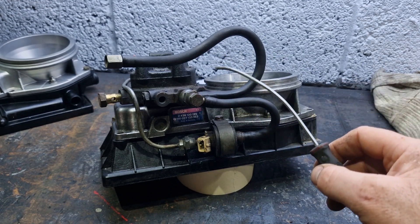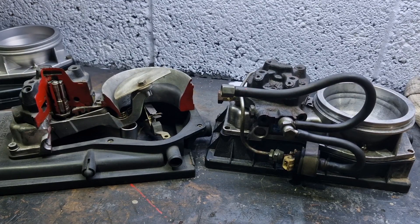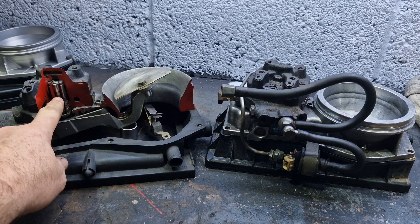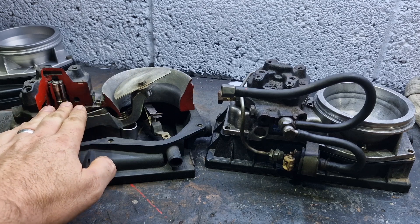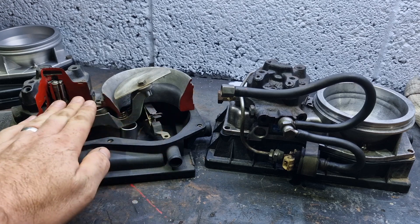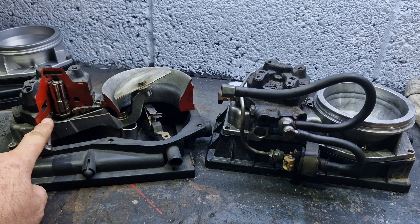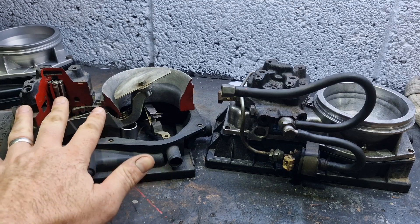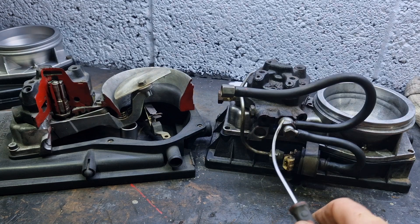If the valve opens a certain amount, the system pressure inside drops — for example, from 5 bar down to 4.8 bar, so we've lost 0.2 bar of fuel pressure. The plunger is still moving, air is still going through, fuel is still going out — but how does the pressure drop make a difference? In the metering head everything is linear: how high the fuel plunger goes determines how much fuel comes out. The diaphragm in the middle maintains an equilibrium — if no fuel comes from the top and system pressure is on the bottom, it stays closed. As soon as the fuel pin comes up it diverts more fuel to the top, making the top the governing body, pushing the diaphragm down and allowing fuel out the injector.